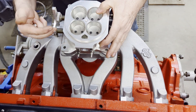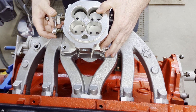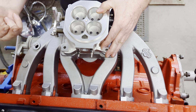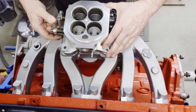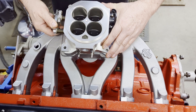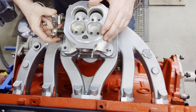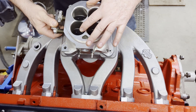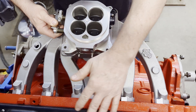It's just a better off-idle and better overall performance. You'll have to deal with your linkage going this way, but that's just part of hot rodding. When you go full throttle, it's going to be fantastic — everything's going to come in equally as the primaries open up and the secondaries open up, giving a nice, decent flow.